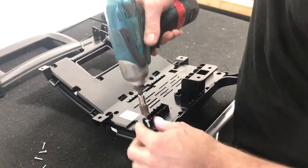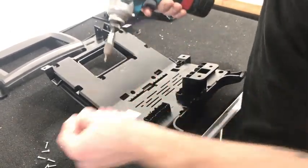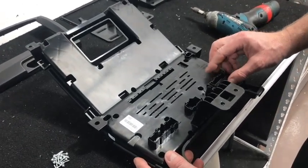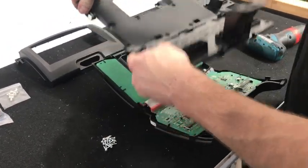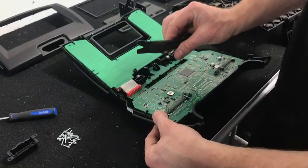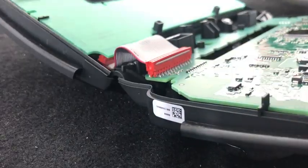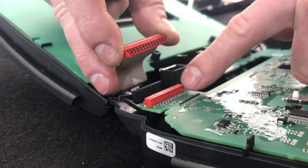Remove all the screws, then pull the little cover off on the right-hand side — it comes off separately. Then pull the backing plate off by pulling it forward gently and up, being careful not to bend any pins. Now we're going to remove the ribbon cable. Use a plastic pry bar for this — the trick is not to go right to the bottom of the plug, but up a little bit. Lever it up and off from the right-hand side, and that removes the top section so you can pull it out of the way.